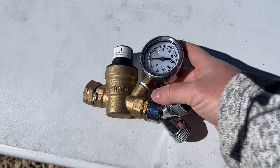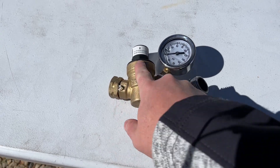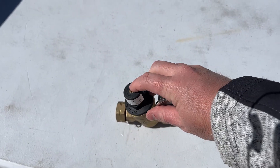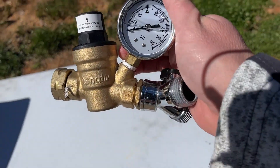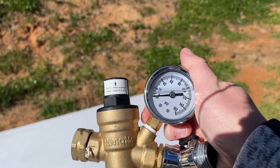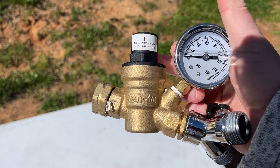I'm going to share what I've learned in case you're having the same problems we did. The most obvious thing is that this is your water pressure gauge and this is your water pressure regulator. This is what tells you how hard the water is coming in, and this is what you use to adjust the pressure coming into the camper. When you hook these up, the pressure that pops up is what they call static pressure - that's the pressure coming from the water lines. When you adjust it, that's the pressure going into your camper.